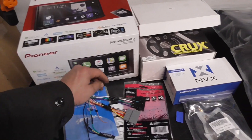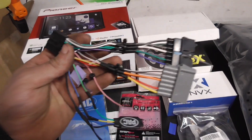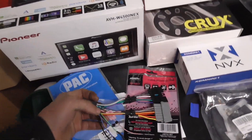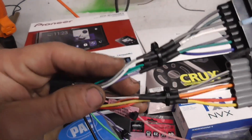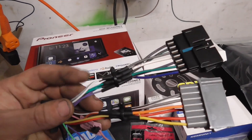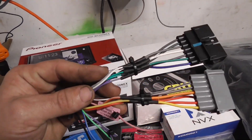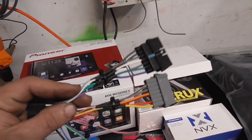Now I'm going to go over the wiring harness. Most of the big radio manufacturers have pretty much all gotten in line and decided on a common color code. So with the Pioneer radio, just match color for color and you'll be fine. If you have an Alpine radio, refer to the installation guide on your radio, because Alpine is the only one — besides cheap or Android radios — that has a slightly different wiring harness where three wires are different, and you don't want to hook them up wrong.